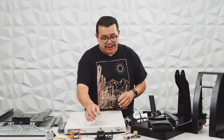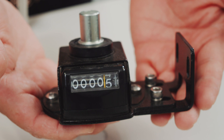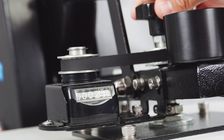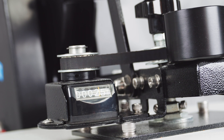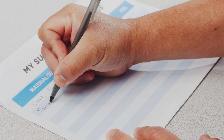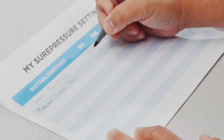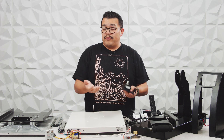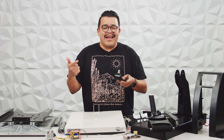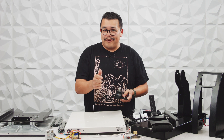A really great feature found on all of our Signature Pro models is Sure Pressure. The Sure Pressure gauge helps you keep track of different pressure settings — as you adjust the pressure on your machine, the number on this dial changes as well, serving as a kind of bookmark. This is very helpful if your shop is constantly pressing different transfers requiring different pressure settings or different materials — going from t-shirts to thick hoodies to sweatpants to denim and back. Having the Sure Pressure system built in, you just keep a list of settings and you're locked into consistent pressure every time.